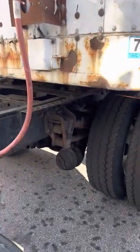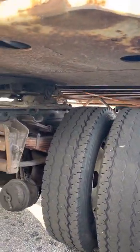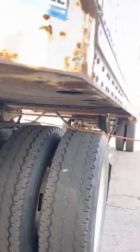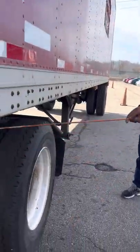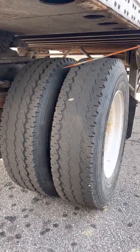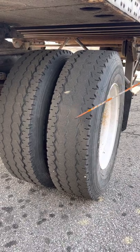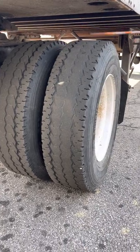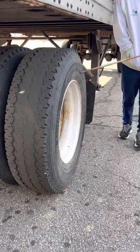When we come here, we have another three different sections because we have another axle here. This axle has the wheels, the brakes, and suspensions — the same thing as in the front. If they ask you to do everything or if they ask you to do section B, you have to explain those three sections again. There are two wheels instead of one — make sure 2/32 on the depth. Between these two tires, no trash, no debris, no stone, it has to be clean and clear. These two tires should not touch or rub each other. No mismatch tires here and no cut or damage on the tire.